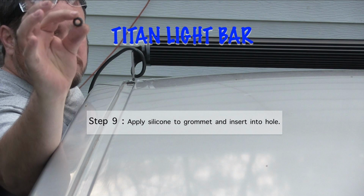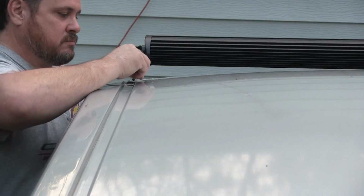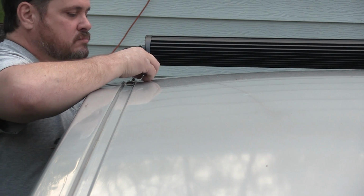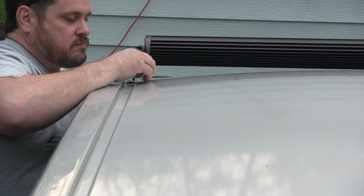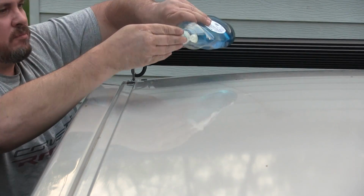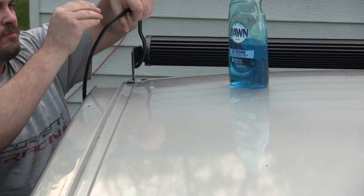The next step is to apply some silicone to the grommet and then insert it into the hole. Now what I did is I just bought an assortment of these grommets. They're really cheap. I'll put a link down in the description. And then you find one that fits the wire really tight, and then drill a hole accordingly to the size of grommet you got. You should select a grommet that fits really tight, so you're going to have problems pushing this through the hole without just pushing the whole grommet through. So what I do is I get a little bit of dish soap and I put it on the cable just to help lubricate the cable so that it will slide through easier.